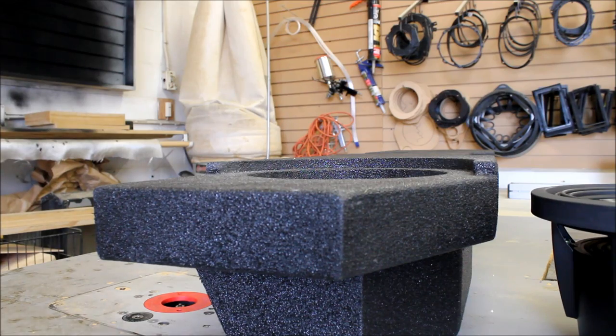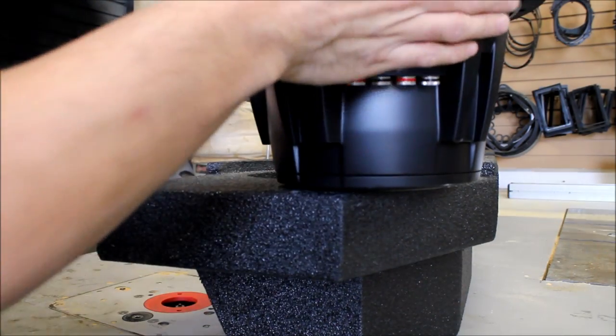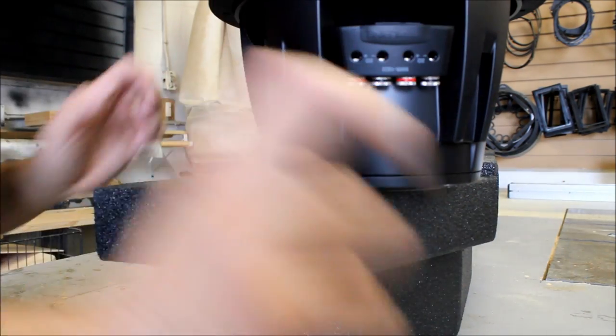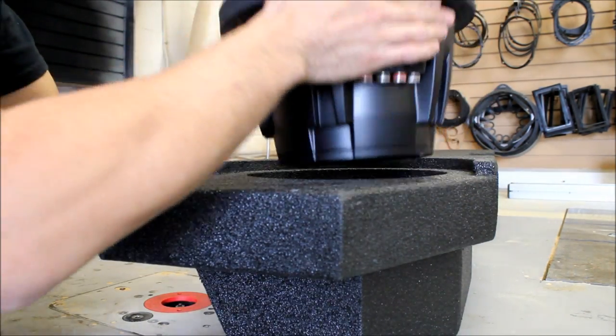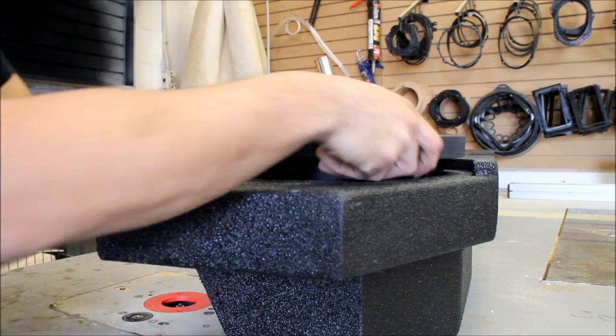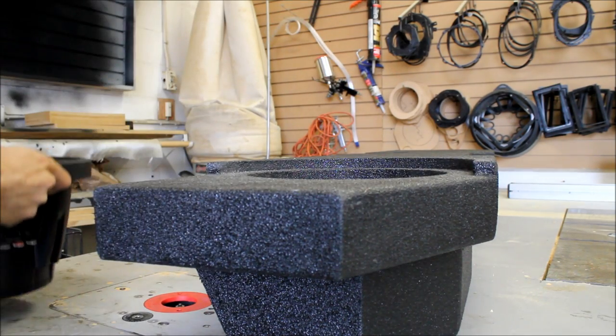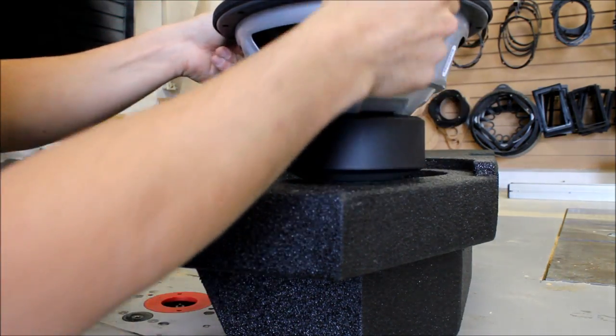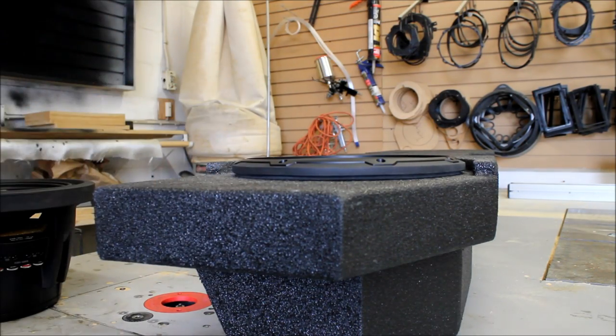So what fits in this enclosure? Let's try the Type R again. This type of woofer is just way too big for this enclosure — we're just trying it because it's a 10-inch woofer. That's as far as it goes without modification, so if you're buying online, don't buy the Type R. Now the JL W3 — the basket tapers off, it's very compact, and it fits much better. It doesn't require a lot of power, doesn't need a lot of volume, it's just a very good-sounding woofer, so I'm going to recommend the W3 in this application.